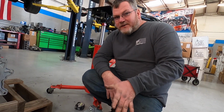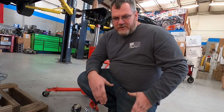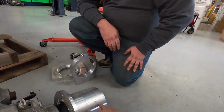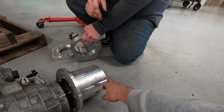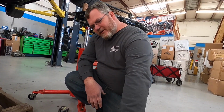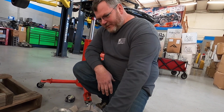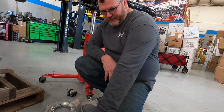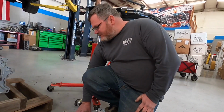That's the game plan. Because if the 6-bolt was bigger, we'd be good. But because it's a smaller pattern than the 5-bolt pattern, it gets in the way of our tube. And he's going to take the 1/2 inch off of the end of here? We were just talking about that, probably. This will actually end up sliding back like a 1/2 inch more for our mounting. But we got plenty of room. We got over an inch back there to slide it back before even the seam right there. So it's pretty cool stuff.